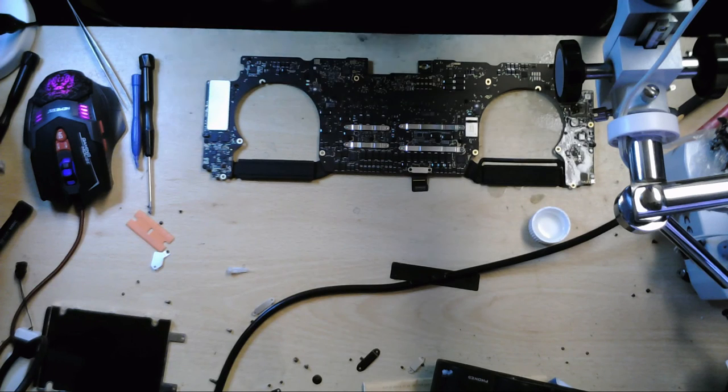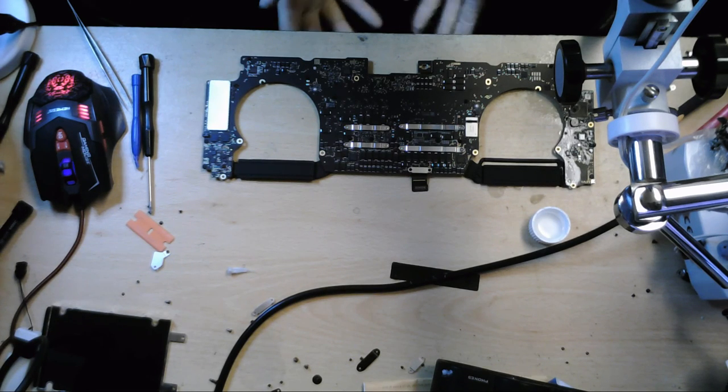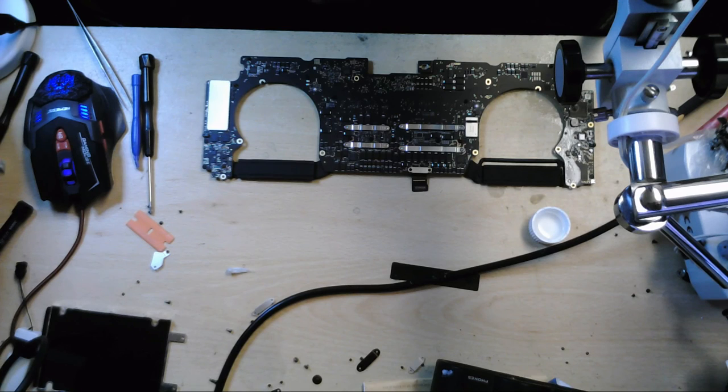But yeah, we're going to have to leave it in an air purifier with some heat for a good 24-hour period, I think, and see how we go. And see how it dries out. I've done laptop screens before where we've dried them out, and you know what? They don't look too bad, but you can always tell that it has been liquid damaged. You can always tell there's almost like salt marks that you can see down the screen. It's obviously a cheaper method than replacing the screen. But as I said before, we literally have no option on this one.